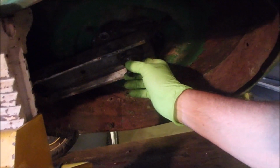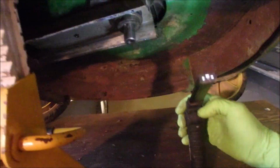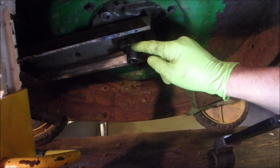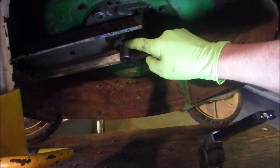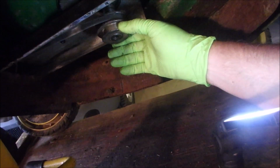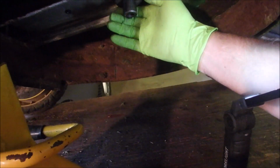You see this right there? Let's get some light. Use the light, Bruce. Okay, that looks a little bit better, doesn't it? So we just line up that threaded hole with that notch I drilled in the crankshaft down like that with the belt on, right? The belt is on. And we tighten it up with an Allen key, and then we put our blade adapter on there.